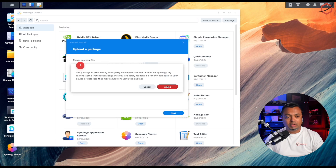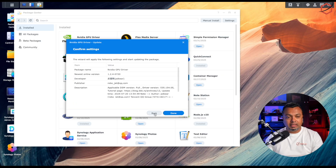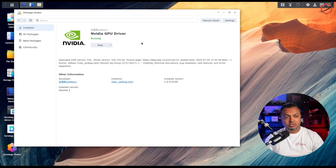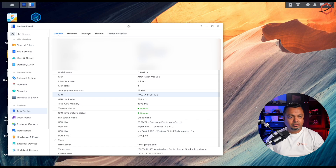Once processing is done, you'll get a pop-up asking if you understand this could affect your Synology — click Agree and accept the terms of agreement, then run through the installation steps. Once the NVIDIA GPU driver is installed, click Run and then reboot your Synology. After rebooting, log back into DSM and go to the Control Panel, then Info Center to check if the driver and graphics card are being recognized.